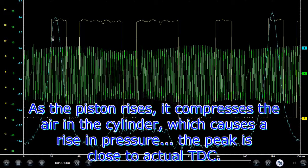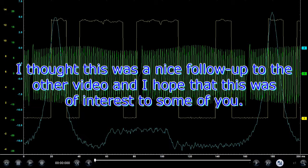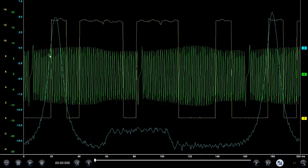The pressure transducer — as you can see the rise here — this is where theoretical top dead center is, as combustion pressures peak. This is where the pressure is, where top dead center is. I thought this waveform would be good for you guys to have, in terms of seeing a known-good waveform for a 2-liter engine. It's a static picture, but it doesn't really matter — now that you know, you just count the teeth just like you did on the 1.8T, and look for the rise in these signals at the same place.